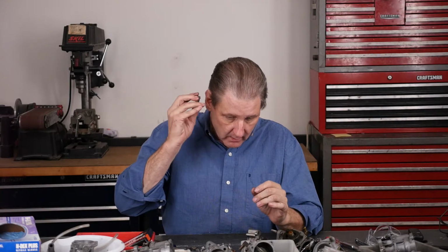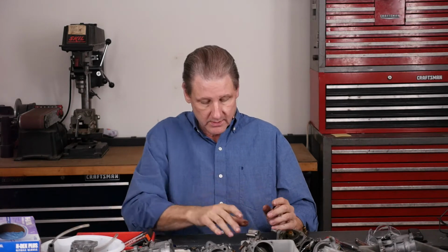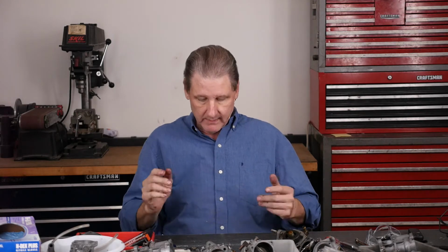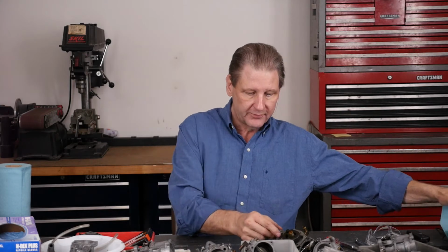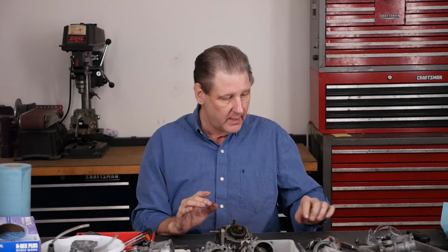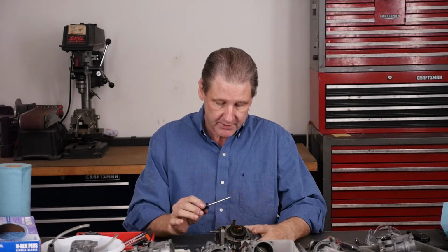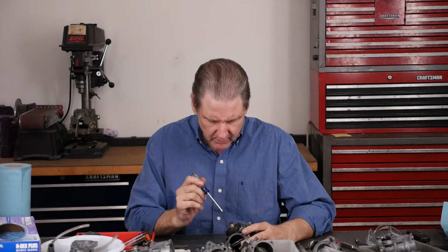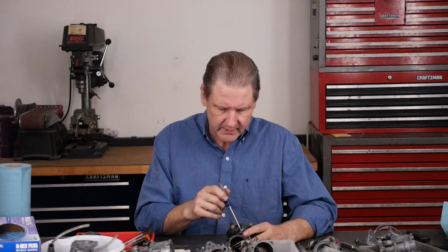So, I can hear it. That's good. That's a good sign. Float bowl. I'm going to stop things now, get a rag, clean up the gas. Now we've got the float off, and it's delicate. The float's a little delicate, so you want to get that out right away. That's where you use the number 1 Phillips, the smaller Phillips. There's one screw right here, right in the corner.